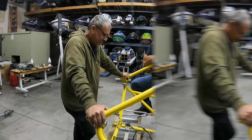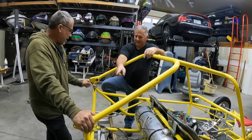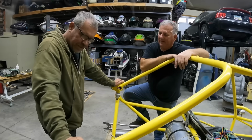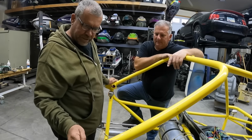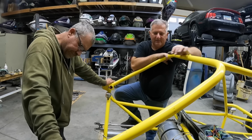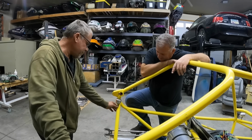Yeah, the wiring's gone out of this. I think this one here. Commonly the tubing's sharp and it cuts into them. So it's hard to prevent these from shorting. Okay, well, that's all right. I'll just rewire it. Pull some new wires.